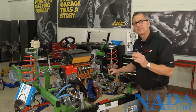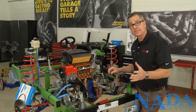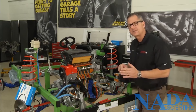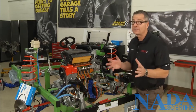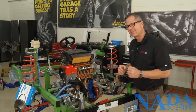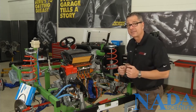Now I want to talk about two types of engines. There's an interference engine, where the valve will hit the piston if it's not in time, and there's a freewheeling engine where it wouldn't matter — the valves have enough clearance. But if you have an interference engine, and most of us do on today's cars, you have to be careful, because you may be running at 3,000 rpm and if that timing belt breaks, that's going to be catastrophic damage.